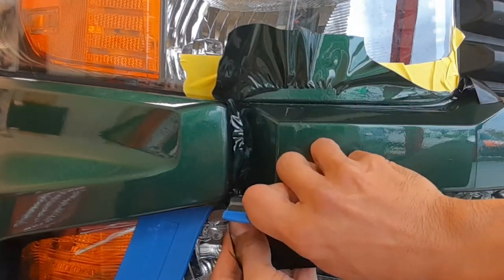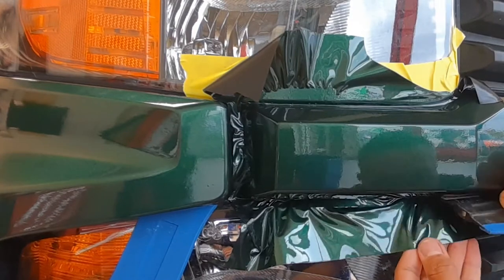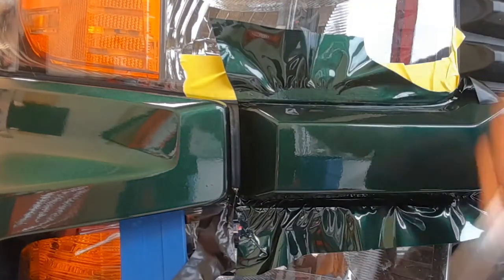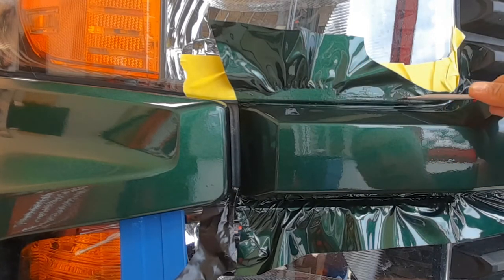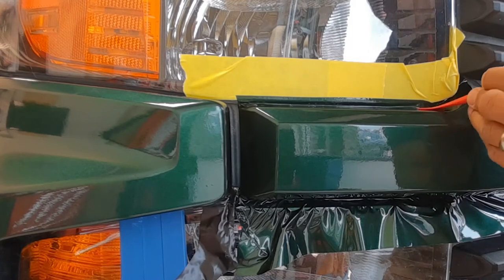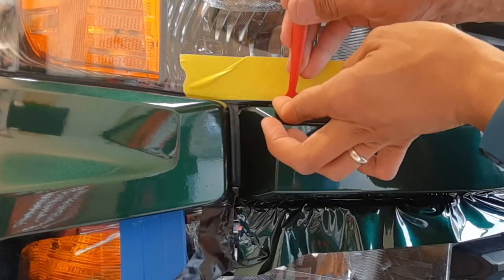On the bottom corner I did essentially the same thing — worked the vinyl over that corner apex, swept out to the left and right on the flat sides, then tucked it in once I reached the backside of the grill bar emblem. I'm applying a little heat to shrink it up because working it back in there did stretch it just a little bit, and the heat will relax the vinyl so it can mold around the corner. Once I've got it set, I trim off the excess. I can reach the backside of the grill bar emblem with my knife blade against the side. I'm cutting up onto the headlight just a couple of millimeters since I have it taped.